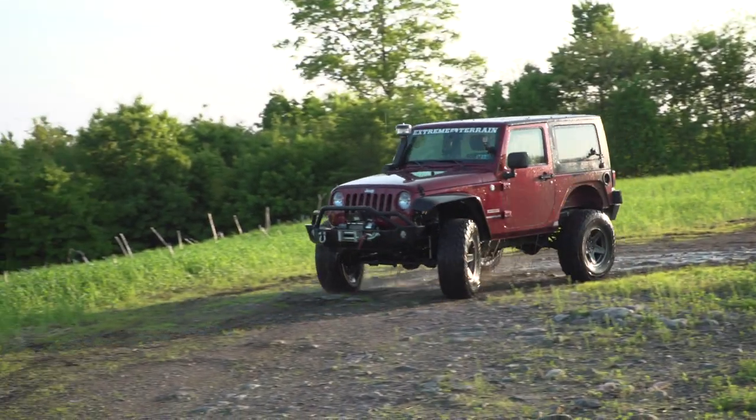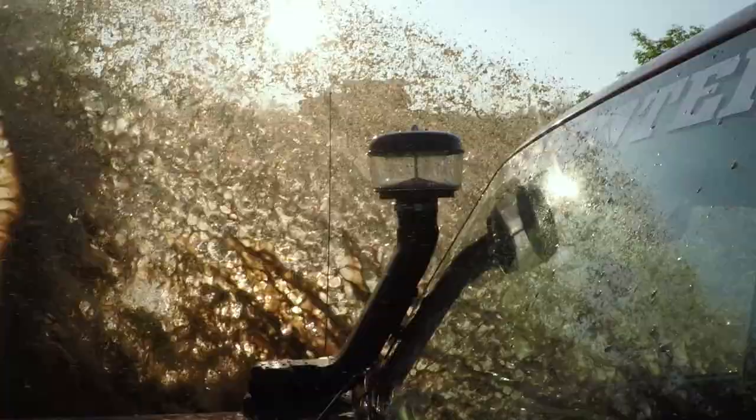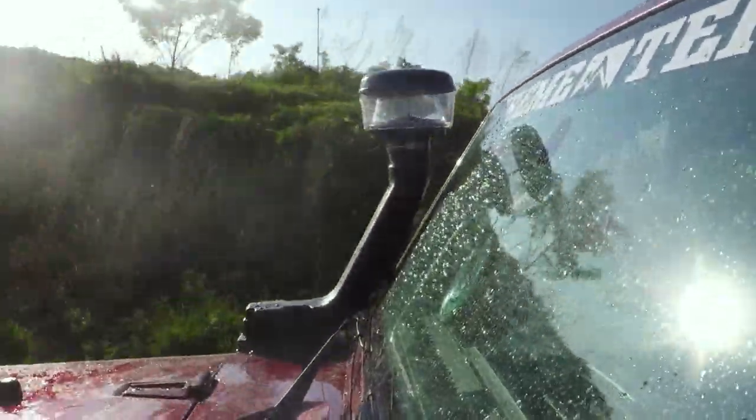Well, I definitely got some water over the hood, that's for sure. And really, that is why you install a snorkel on your Jeep. It's not necessarily about the total depth of the water that you're driving through — it's if you're coming off a bank and have a really steep entrance where that intake might get dunked under water. It's if you want to just go out there and rip around and go fast and have a good time. I have the confidence of knowing that none of that water is going to get sucked into the engine and not just ruin my day, but ruin my year if I have to buy a new engine for my Jeep. I would absolutely not do that with a stock intake, but I feel perfectly confident doing it with a snorkel. And that's what running a snorkel is all about.